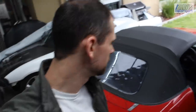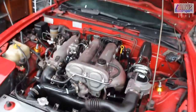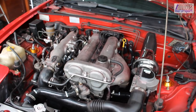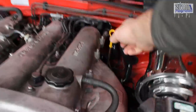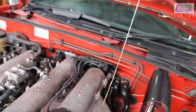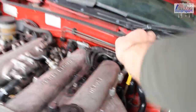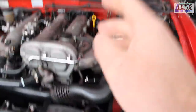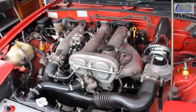Let's look at probably the next most important thing, which is the engine. In this particular case we're looking at a reasonably standard 1.6. Obviously, the first thing I'd be looking at is your oil level — pull your dipstick out, give it a wipe, put it back in, and check how much oil you've got. You really want at least halfway up the dipstick marks. If you've got no oil at all, it's probably the biggest killer of an MX-5, and an owner who doesn't check their oil is probably a person you don't want to buy a car from.